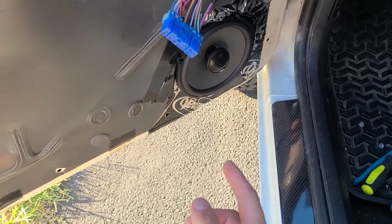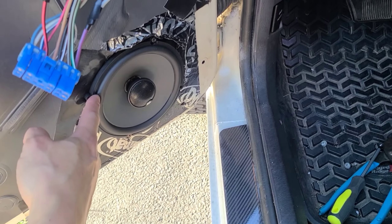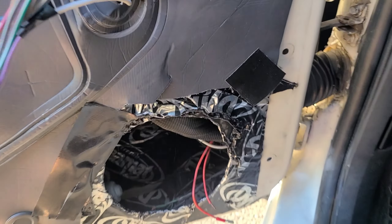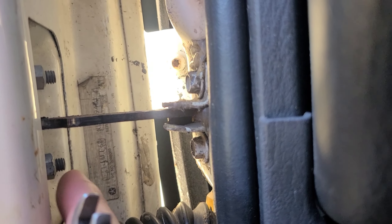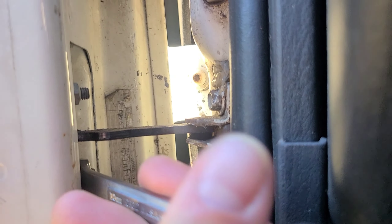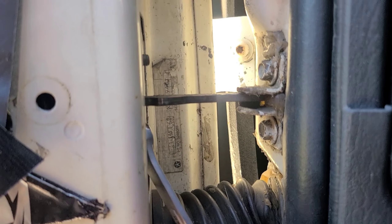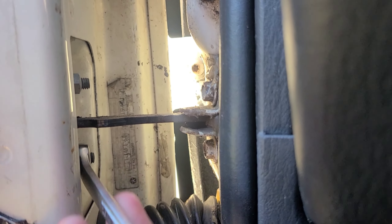Once that's out, you've got to take out your speaker — it's going to be behind there to get to your arm. Now with that out of the way, on the door there are two little nuts right there. Mine are 10 millimeter. I've found out real quick my Jeep is different than others, so we're going to loosen these to get this out of here.